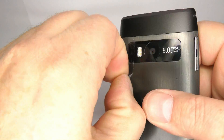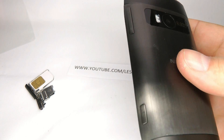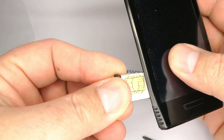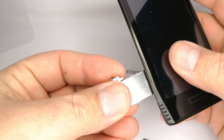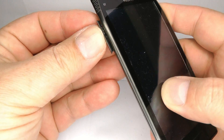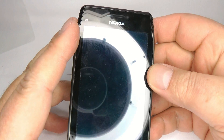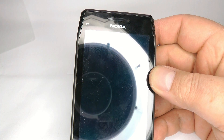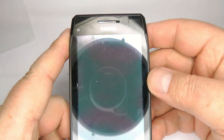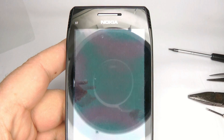Remove the sticky tape from the volume and camera buttons, then reinsert your SIM card and your memory card. You'll probably find it won't switch on immediately after having it apart — if it won't switch on just plug it into your USB port and you'll find it will switch on after that. Thanks for watching; please give me the thumbs up and subscribe and I'll do my best to make some more in the future.